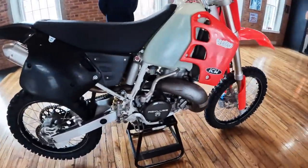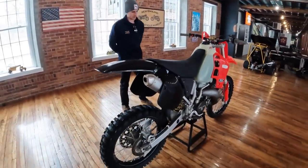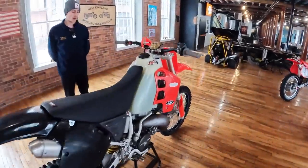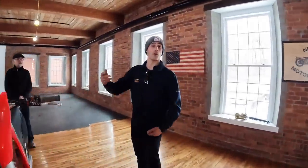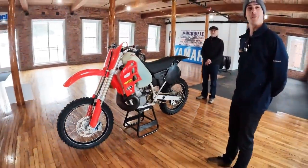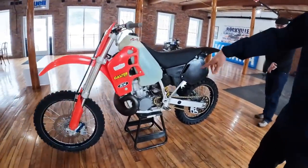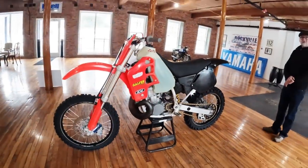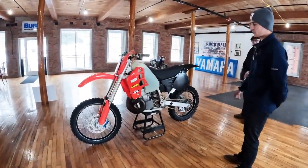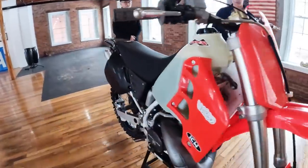That was always cool but worrisome at the same time, considering we ring them out a bit more than the average rider. After that I decided to do a frame-off. I pulled the motor out, pulled the top end off, and found the OEM piston was cracked from the bottom of the skirt all the way to the top — we had about five to ten more minutes of ride time until she exploded. I sent the cylinder out to Millennium, they replated it stock bore, and I think they cut the head a little bit to run race gas. I checked the crank — no side to side, no up and down, it was tight — so I left it in, cleaned everything up, put an OEM clutch in it, and put it back together.